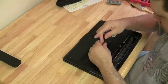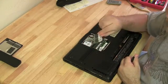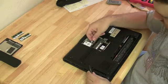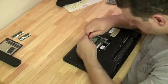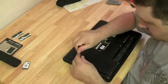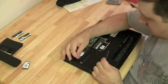If you're still having problems with the computer acting abnormally, start taking out components one by one. Remove the hard drive if you're running from a live Linux distribution, take out the RAM and replace it with a known-good stick, remove the wireless card, and remove the CD drive. Get the motherboard down to basics: CPU, one stick of RAM, motherboard, and power, with just the screen connected. If it's still abnormal after stripping it down and ruling out Windows, it's probably a bad motherboard.